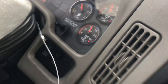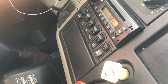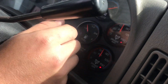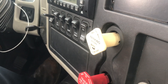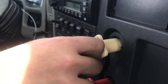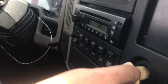Now, about 45 PSI — you should push this parking brake in, and at about 45 PSI, that parking brake should automatically pop out. Because in a low pressure emergency going down the highway and you're losing a lot of air pressure, this parking brake should pop out so you can stop. So we're going to take this down to 45 — you should see this pop out. It has yet to pop out, so that failed. It's not within spec. I'm almost at 30 PSI and it still hasn't popped out. So that's bad.